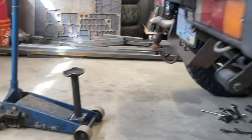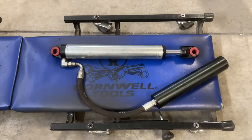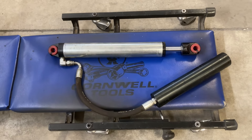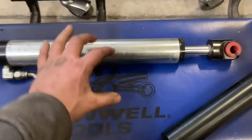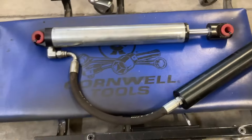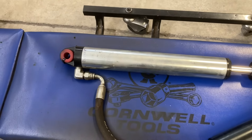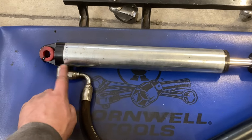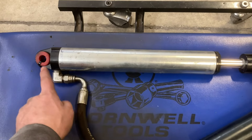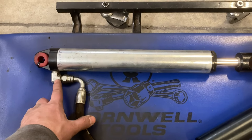So what we're doing is I pulled off the shocks off the rear. These are FOA 2.0 by 10 — that means it's a two-inch body diameter, 10-inch travel. You can see it's a remote reservoir. To fit the Samurai, I had to add the second 90-degree fitting. I ordered them with this 90, but just to clear everything that was under the vehicle, I added this one.